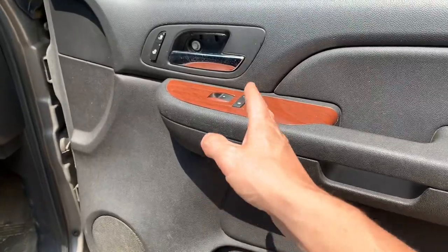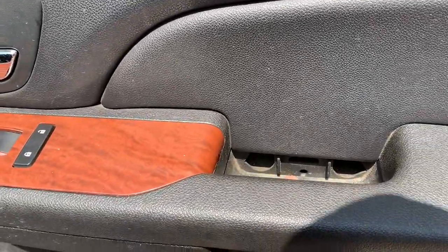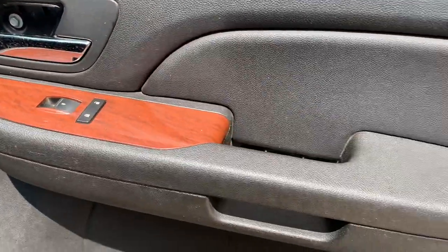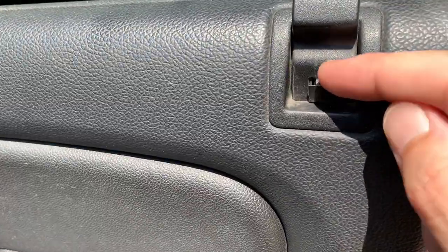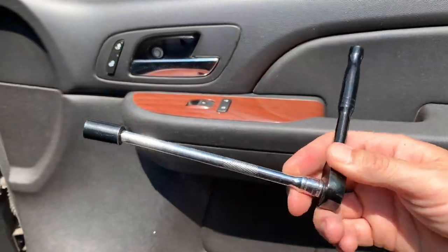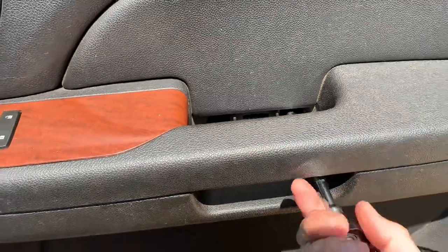Some of them have a vertical armrest like the Avalanche, and there's a cap on it you have to take off. But in this case there's a cap behind the armrest, and there are two 10-millimeter bolts. There's another cap behind here with one 10-millimeter bolt. This triangle piece has to be freed — it just pops out. There's one tab here that has to be up, and this smaller clip here has to be popped out. If you have a long extension on your quarter-inch drive, that makes it handy to spin the bolts out.